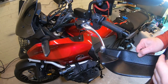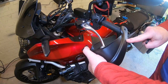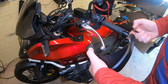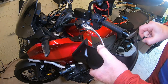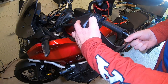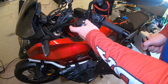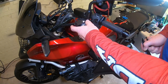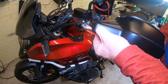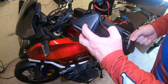From the design of this GP handguard, there's no problem with the lug for attaching to the bar end — it needs to go outside the bar end, not inside, no problem there. But when it comes to this part of the assembly, you can see the pre-drilled hole doesn't match up with anything whatsoever on this bike. However, where I removed that five millimeter allen bolt, there is obviously a threaded recess for that bolt. I reckon if I drill a hole there and use a spacer of some description, I can actually get that to work, and I'll plug the original hole with a rubber grommet.